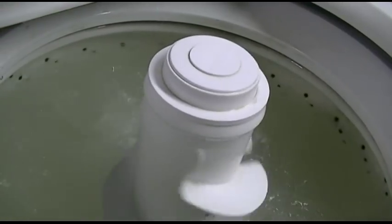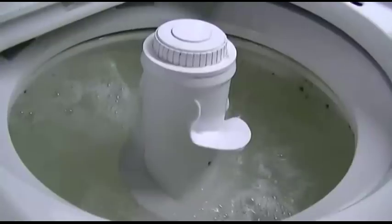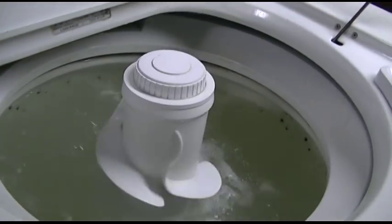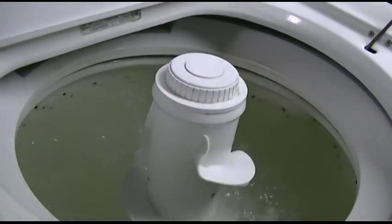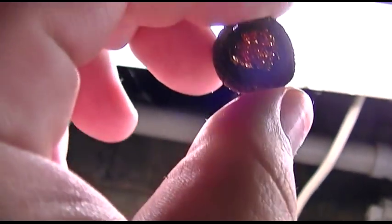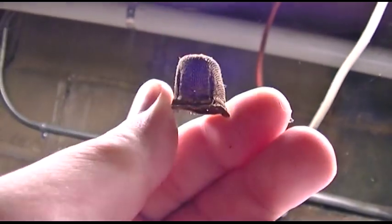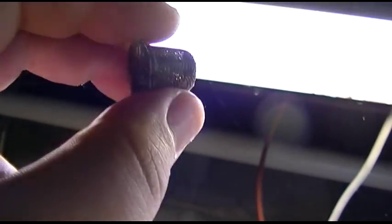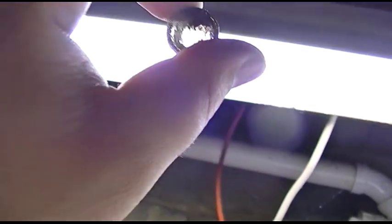It should be going into low speed agitation pretty soon. This machine has a pause before it goes into low speed. I had to pull out the filter screens — as you can see, even if I hold it up to the light, there's not much that's going to pass through that. They are just completely shot because of the quality of water that we have. The other one wasn't as bad — that was the cold; this was the hot. She doesn't use hot much, so that one was pretty good, but they're just too far gone.